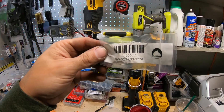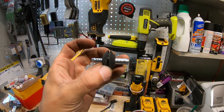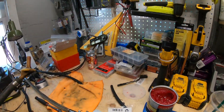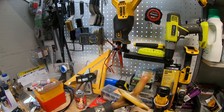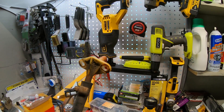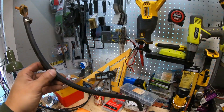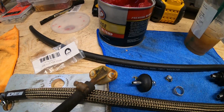The next thing I'm going to do is install this Go Westy part right here. What it is, is a bushing that goes into the firewall. This would be your plastic line — looks like a quarter inch — and this would be your fuel line at maybe a half inch diameter. It's actually replacing this plastic firewall bushing right here, which from what I found and researched online, these are one of the main issues for Vanagon fires. And look how stiff this hose is — it doesn't even want to bend. So these hoses definitely need to be replaced. To the left is the old, to the right is the new one.